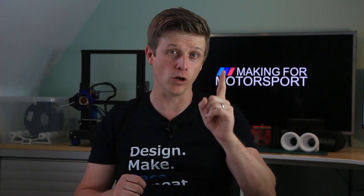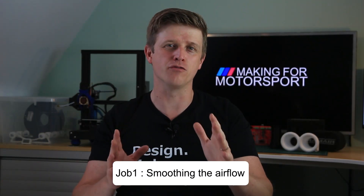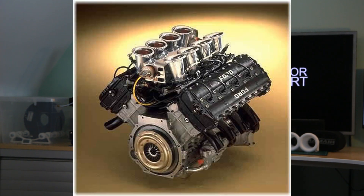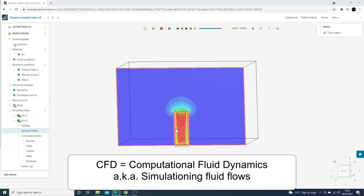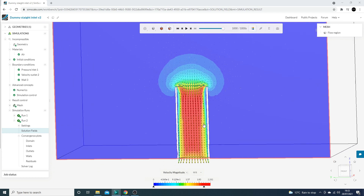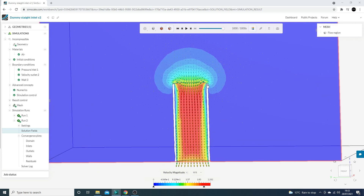If velocity stacks have one job, it's to smooth the flow of air into the inlet tract and then into the engine. That radius isn't there just to look cool — it's got a real purpose. Just check out this CFD of a straight inlet pipe: a hard edge or a corner will generate areas of low flow just downstream from the inlet, shown here in blue, and you can see the shape of the red region — the fast-moving air.